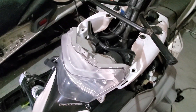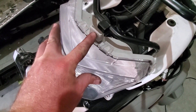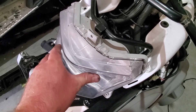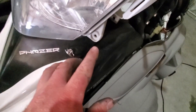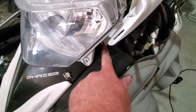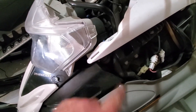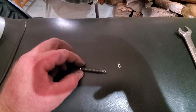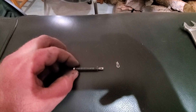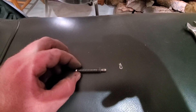Then we have the headlight. It has a screw right here — a little plastic screw that goes in that hole with a little keeper — and once the screw is removed the keeper will pop out and the top of the headlight will come loose. Then down on the bottom there's a screw with a spring behind it that screws into a keeper. The hardest part is on the very back — there's a little clevis pin. You have to take the clevis pin off first, then unscrew the screw and catch the spring before it falls down inside the motor area. There's one of these on each side of the headlight.